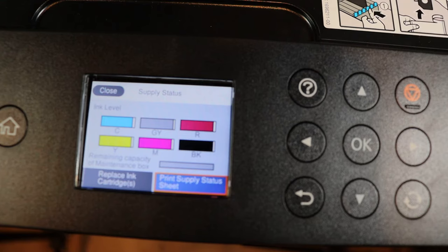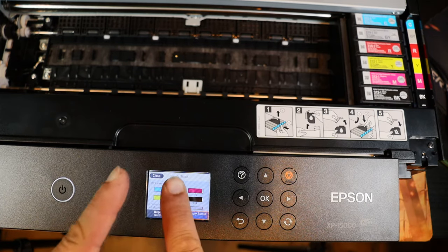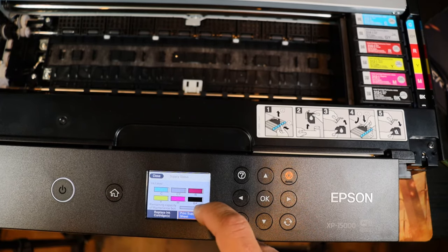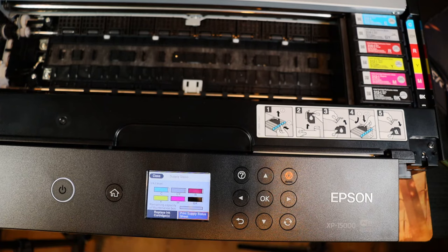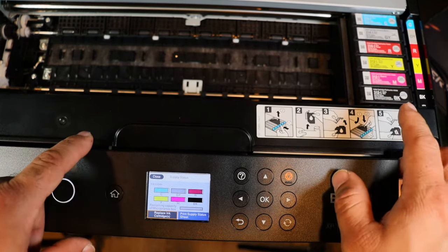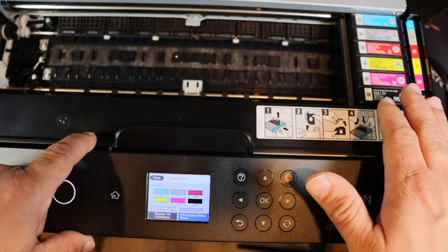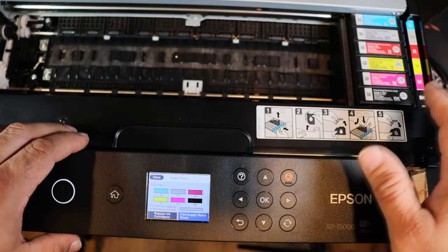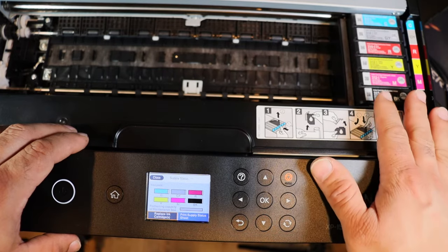You're going to do that to reset your ink as well. If your ink levels are too low, remove your waste tank, reset it, put it back, click OK — that's going to bring all your levels back to the top. Right now because we haven't done the chipless firmware update, you're still seeing the stock inks. However, when we do that chipless update, every time you reset your waste tank it's going to reset your inks also — so you don't have to keep replacing cartridges. Why? Because replacing cartridges does almost a print head cleaning — it's trying to push the air out, doing an initialization. So you're going to be wasting ink. Don't waste a lot of ink; reset your waste tank — that's going to save you a lot of ink.